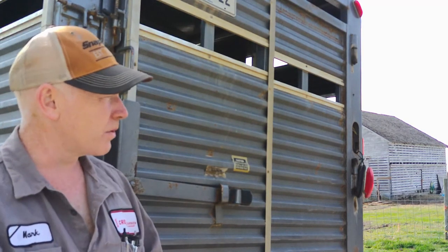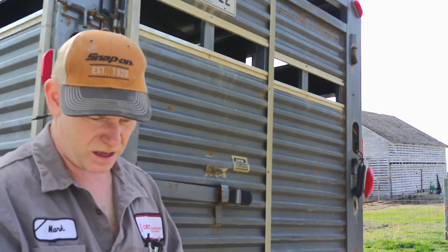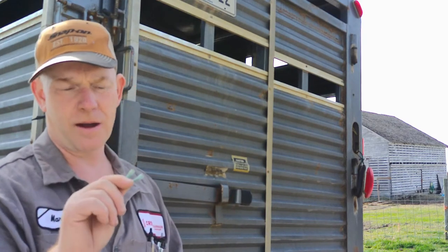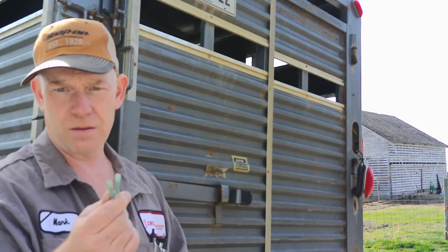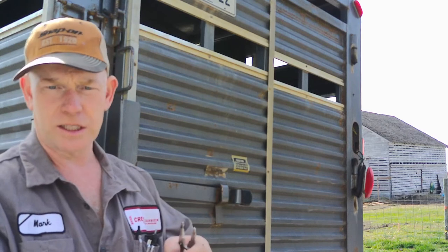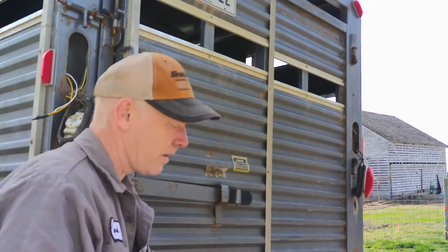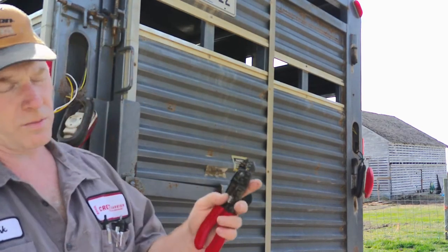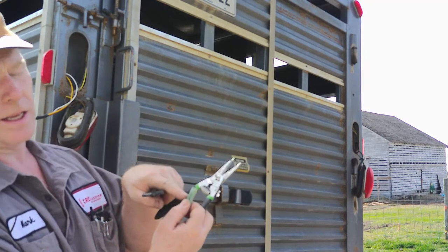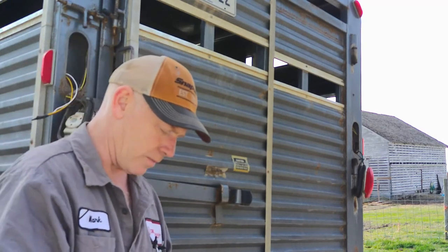Ground wire connections aren't that important — you don't really have a problem with them corroding. But these are going to be power circuits. So I've got some heat shrink butt connectors — they used to be blue but these things are ancient. You crimp them, take a torch, wave it over them and they shrink down and seal the connection. There's a silicone sealant built in that oozes out and seals around it to make a nice connection. You've got to make sure you use a set of crimpers made for insulated connectors. If you just use regular crimpers, you'll break the insulation and your seal is worthless and it's just going to corrode. So we'll use these insulated butt connectors.